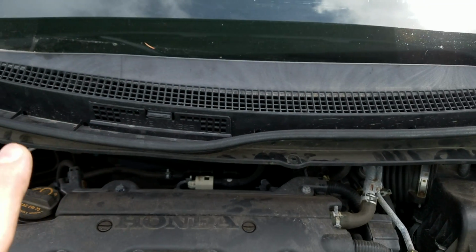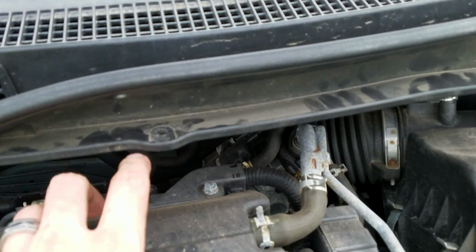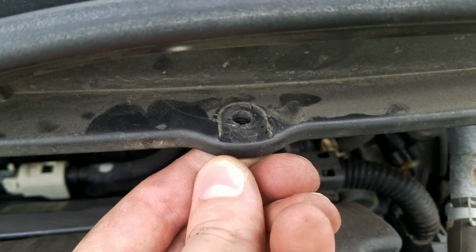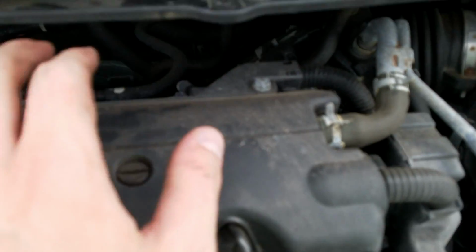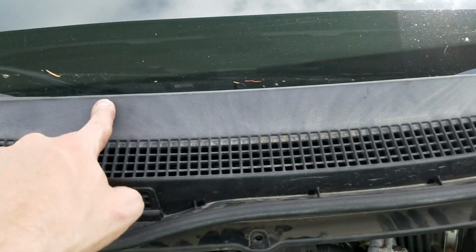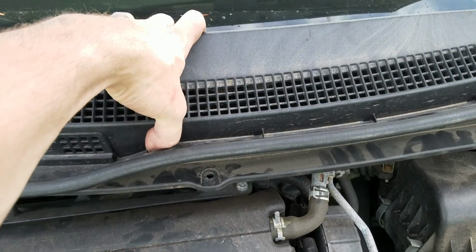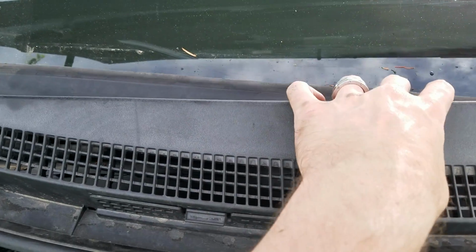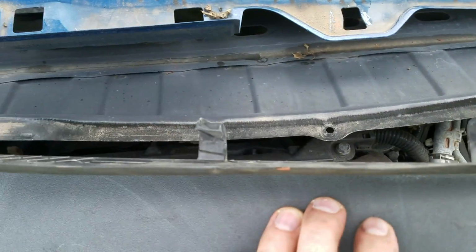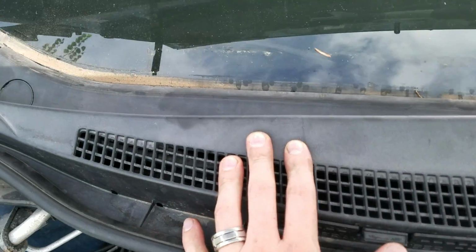Now the new one, once you get the lines all put in, you're going to have to finagle around a little bit, but a good thing I got to get it in was you need to look at this pin right here to make sure it's actually in the right hole where it should be. So you need to touch the bottom of this first, put it down, and then in, because each one of those pins needs to be in their proper place and then pushed up. So if I push this back out, it'll slide out, and then if you bend it back up, you can see here are all the holes, and here are the pins. You just need to make sure it's in the right place, just a little bit below.